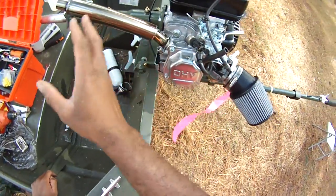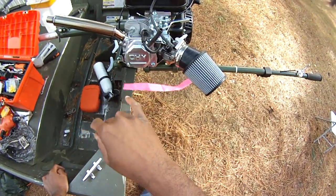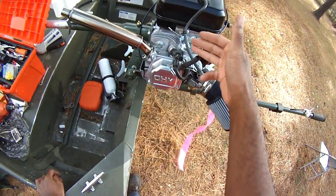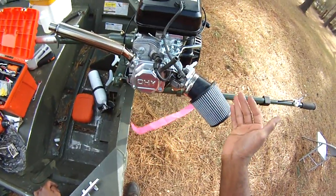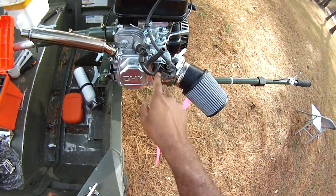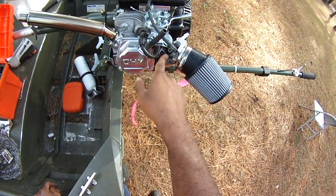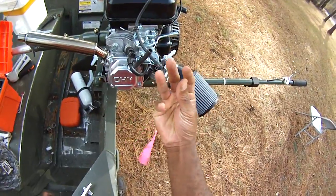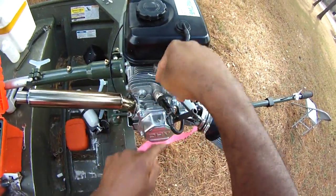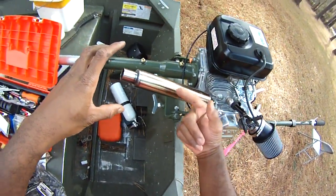Oh my gosh, that is a nice looking thing there. So if you can see the original motor that I had, now this thing is really nice and open. We got lighter components. We're ramming a lot more air into the carburetor. The Venturi accelerates that air, so the air is moving faster and you're getting more air. We've jetted the carburetor with a number 37 jet, so it's drawing more fuel. It's mixing all that and just shooting it straight into the cylinder here. Spark plug ignites it, and you've got this nice little exhaust pipe that gets all that extra burnt stuff out,